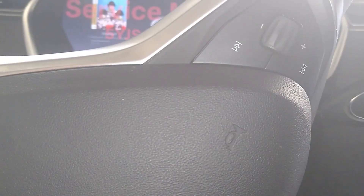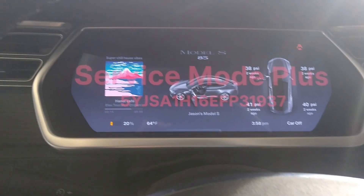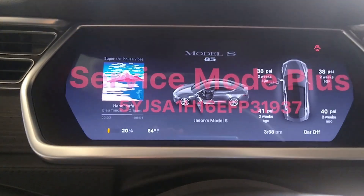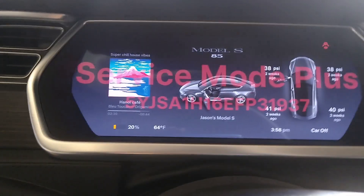I think I still need to run a couple commands in the Tesla Toolbox. All the doors and windows are closed. Key not inside the vehicle — let's touch it right here. I had to touch it exactly to that spot. It's in reverse, it's in drive. The key that came with the BCM is working, but it just has to be right on the spot. I'm not able to program other keys, so hopefully Tesla can work that out. But either way, I got the car un-bricked, which is the major problem. I think the customer will be happy about that, and I'll just tell them they need to take it to Tesla to get the keys programmed.